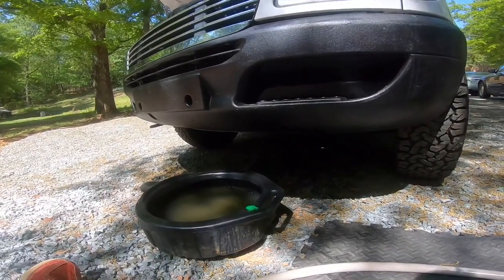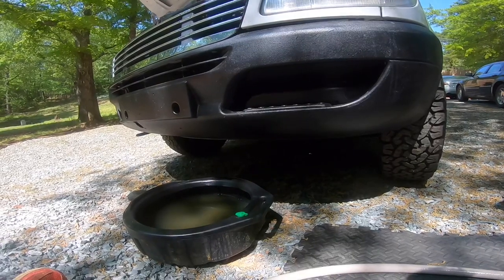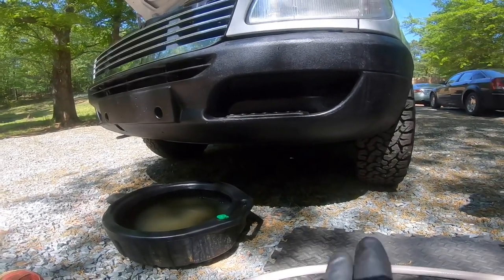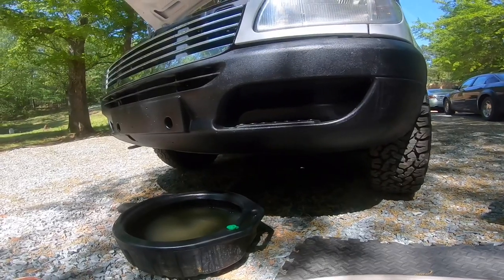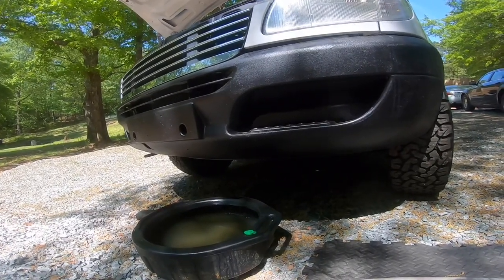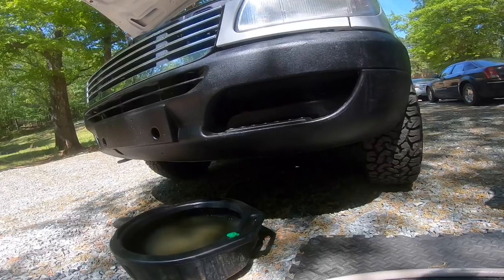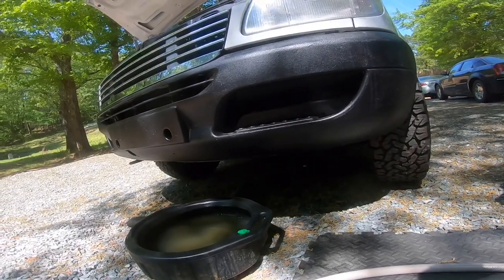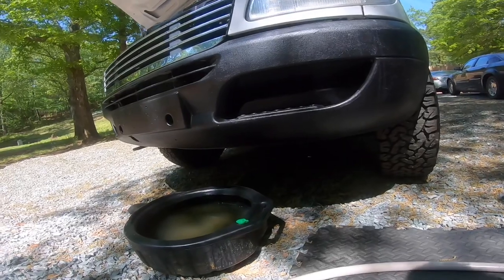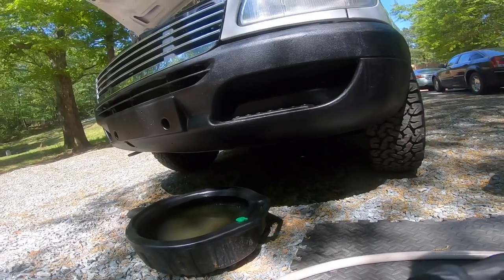The logical thing to do is use 100% concentrated coolant, because there's about two gallons of water inside the engine. If you put two gallons of full concentrated coolant in, it mixes with the two gallons of water already in the engine and it becomes a 50/50 mix. Now, if you've lost some coolant and you're replacing a radiator hose, in that case you've already drained 50/50 mix. Since the engine is already mixed, just use a 50/50 mix — either mix it yourself or buy it premixed — because the engine is already mixed. When you drain the radiator you drain about two gallons, so get a 50/50 mix.